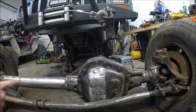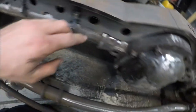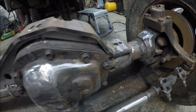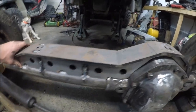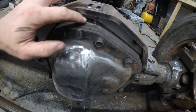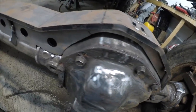We got all the paint grinded off the axle, so now we'll be ready to start tacking stuff on and get ready to weld everything up. I went ahead and welded a little bit already — that just keeps the bottom plates from moving on me. When I weld these up I'll start on one end and work my way to the other end. That'll help keep from warping the axle, because that won't put a lot of heat in one area. I'm also going to wait and weld on the casting last, because I need to heat that up to about 300 degrees before I can do any welding on it.